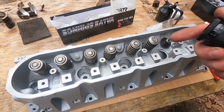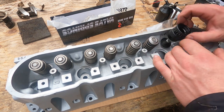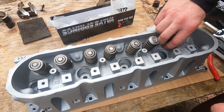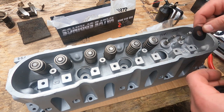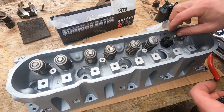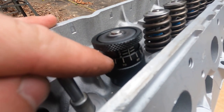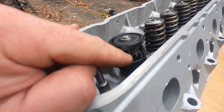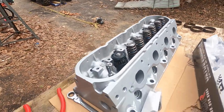We're back at it to fix the cylinder head dilemma. After height-miching again I got 1.838–1.840 inches. The fix is to get the correct size shims — in this case about 60 thousandths — to bring the installed height down to 1.780 inches. I threw the 60 thousandths shim on, put the spring locator on, and measured again. With the 60 thousandths shim in there we're right at 1.775 inches — that's within five thousandths of our targeted installed height. Perfect. We do this through both cylinder heads and then we can install everything.